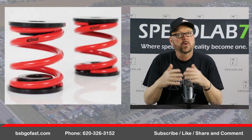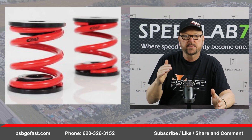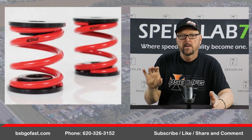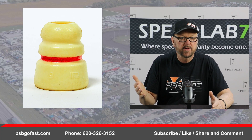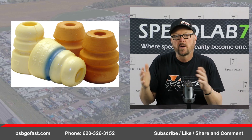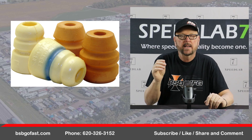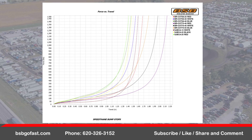You can also run a bump spring, and a bump spring has been maybe a little more popular because it's so straightforward — people feel comfortable saying 'always a 600 bump, I know what that means.' But the bump foam has many more characteristics where it's very progressive, and that's very much what we need on the front of our cars versus a bump spring. This is another reason why we chose the bump foam over a bump spring — it's maybe a little more complex to understand, but you get exactly what you need: a progressive rate along with your main spring.